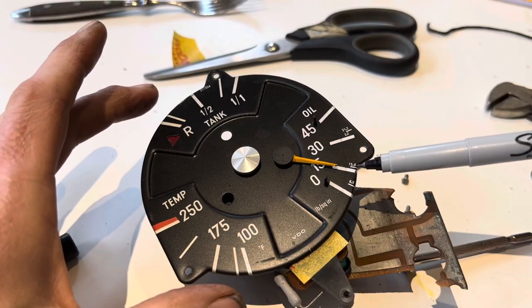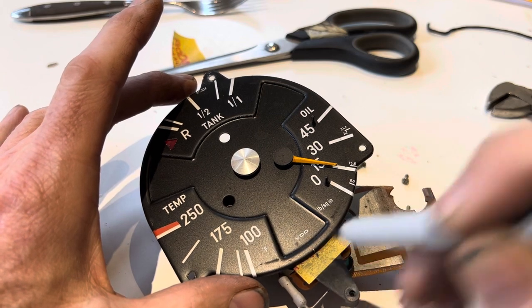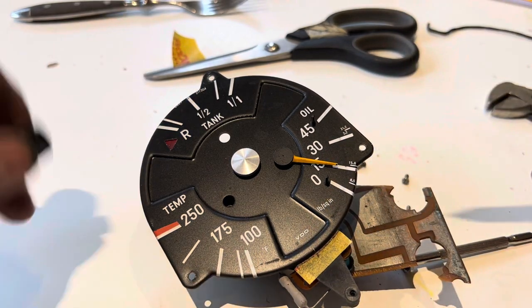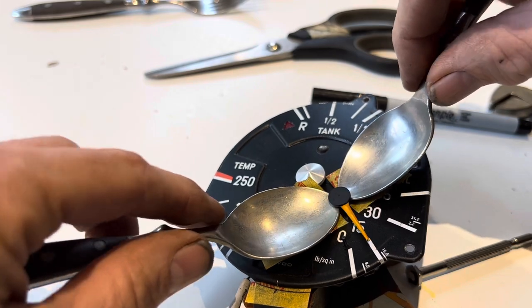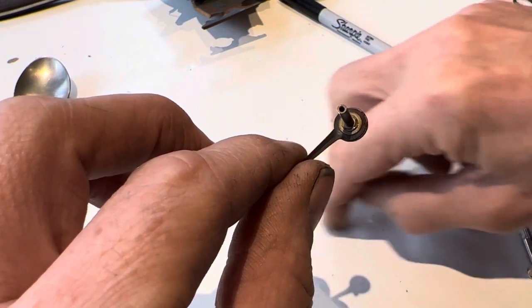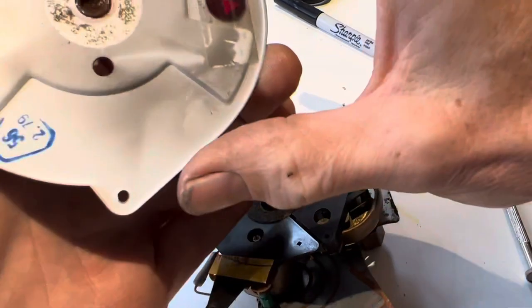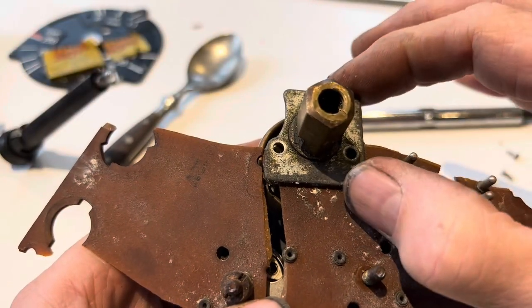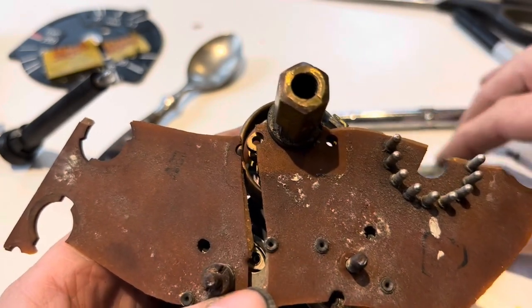This is now perfectly aligned on the 15 of the oil pressure gauge. I'm going to mark that and draw a line to follow the profile of the gauge — that should allow us to put the thing back together properly. Now the last gauge: the oil pressure gauge is different from the others as it has a hollow shaft, whereas the other gauges have a needle pin. Having got the needles off, this should now just lift off revealing the gauges behind it. Once you've taken those two screws out this whole plate lifts off — this plate just clamps that gauge to the circuit board.